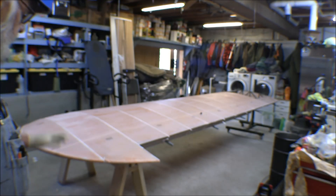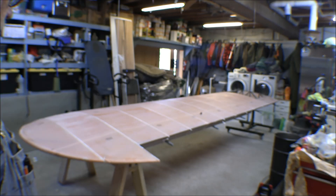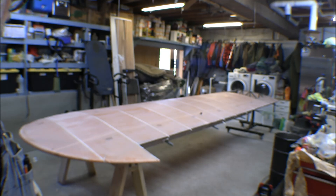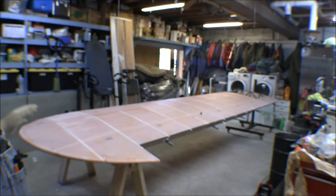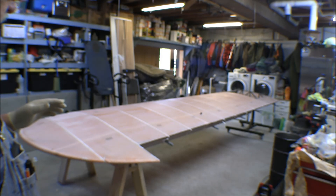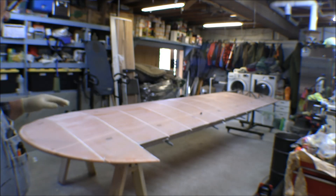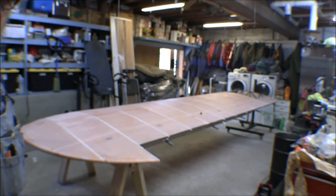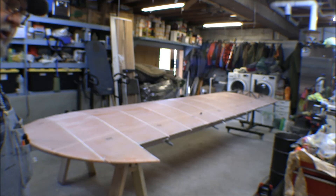That side doesn't have near as much contamination from the wax as the other side will, because the cord just kind of went around this side. A little bit of fingerprints from doing the stitching, but it got pretty well cleaned up. I've got Prepsol wax and grease remover and went over all that — that's all cleaned up. I'll need to let that flash off before I put the poly brush on, but I'm going to go ahead and go over the whole thing on this side and straighten out any of the tapes or strings that might be out of position.